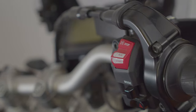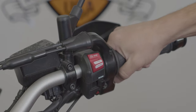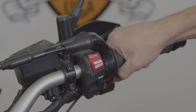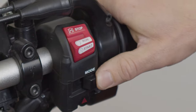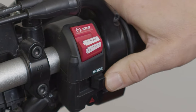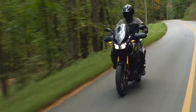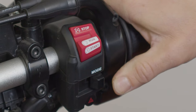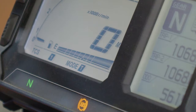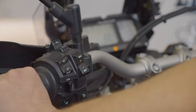Let's start with the switches on the right handlebar. Always make sure the red ignition switch is in the stop position until you're ready to ride. The right arm will always have your throttle, as well as a mode button to switch from sport mode to touring mode — touring mode being for a much easier, more pleasant ride over a long journey. Simply moving the switch left will decide which setting you want. The tachometer will also display an S or T so you always know what mode you're in.